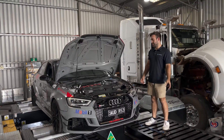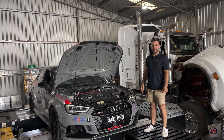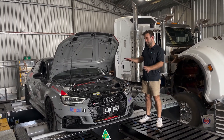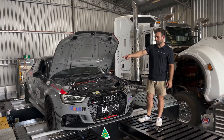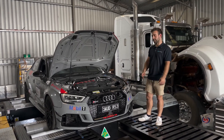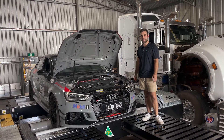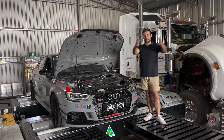Hey guys, we just finished up the Targa RS3 — some incredible gains. We've got a 90 wheel horsepower gain and 150 wheel newton metre gain, which is insane. That's on an open stock file with this hardware. Just to reiterate: we've got a LeBord Motorsport carbon fiber intake, the LeBord Motorsport racing spec RS3 front cooler which is 125% larger than stock, and we've also got a LeBord Motorsport downpipe upgrade as well. All that work has been done and it's provided us with some fantastic figures. We've got a flat torque graph — I'll put that on now.